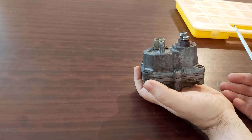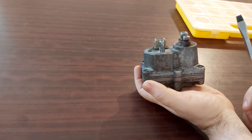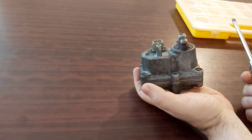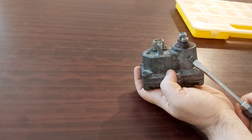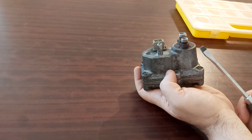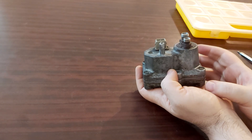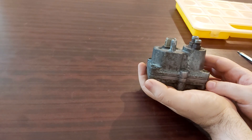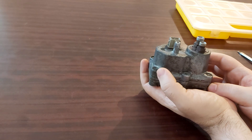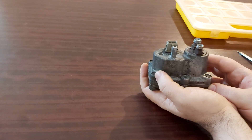The more those plates go higher, the more they close the passage to the fuel distributor and our mixture becomes leaner. At first we have an extremely rich mixture in order for the engine to warm up. As it reaches operating temperature, it achieves its ideal differential pressure — those plates go up and stay at a certain height where they maintain that pressure. That's how it works.